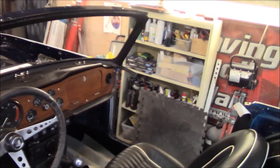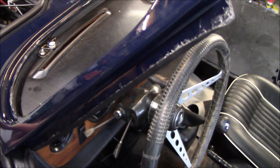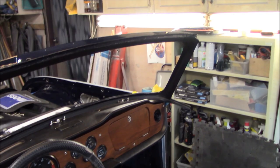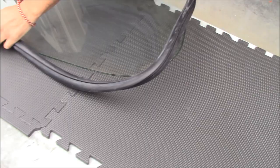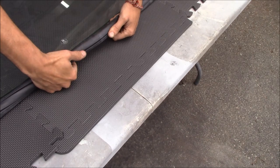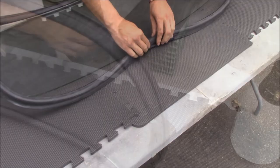The windscreen is installed along the top — I'll do the fasteners later, but we've got it in solidly enough to put the glass in. That seal went in pretty well; we did get some anti-seize everywhere as per normal, but that'll clean up. Next step is to put the windscreen seal on the outside of the glass — you want to put it so that the locking channel is to the front, making sure you get it in the right groove. We're going to put the join at the bottom.